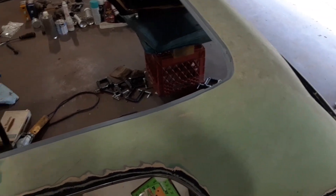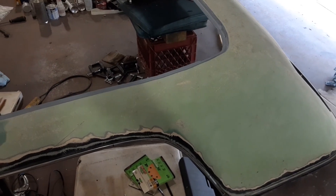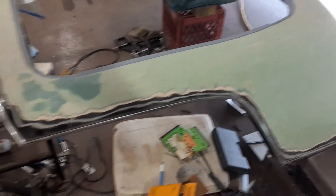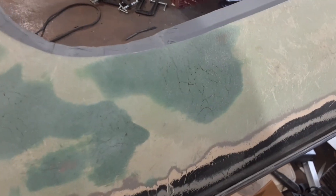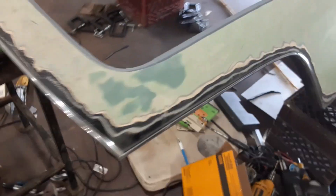Two days, about four hours or more. I used a 40 grit down to the final layer, and then I changed to 80 grit. Later I'll go finer and it's in pretty good shape. It has some maybe minor little cracks in it, but I think maybe the filler primer will handle that.